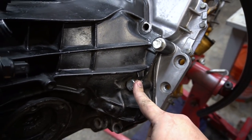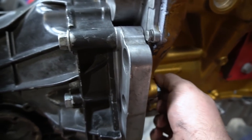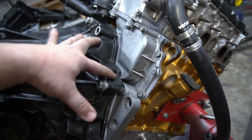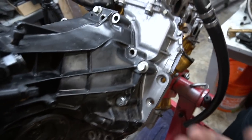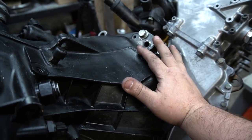So there's the back side of the transmission bell housing — here is the one bolt that goes through the transmission, the adapter plate, and the block. One bolt, a little thread locker, and it's going to keep your car and transmission from flexing from either side. We've also used several dowel pins in the transmission and the adapter plate, so this is just added security. Some people might say their car ran fine without it, but those guys ran these swaps for like 400 miles and then parted it out. If you're looking to keep these swaps for a while and you're looking to compete, we're adding as much reinforcement as possible.